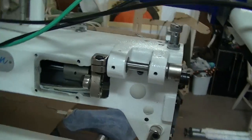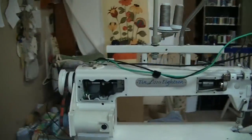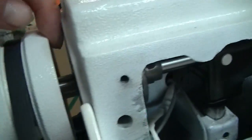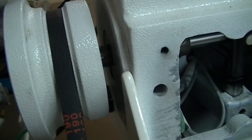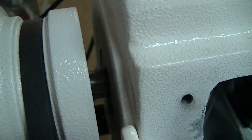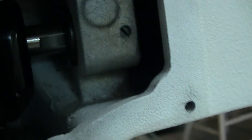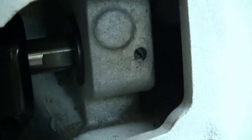It's like, what in the earth could it be? What can it be? So what it turned out is it was this bearing back here on the shaft. And they said do not oil the back. Been told that by a rep. Everything else. Let's see if I can get in there a little bit. That was the only thing that was left. So I went ahead and oiled a little bit there, and then oiled on the other side of that, and then it started running really good.